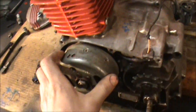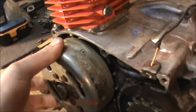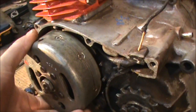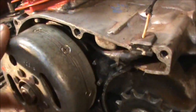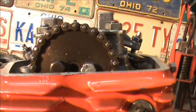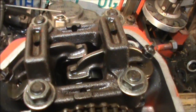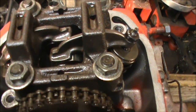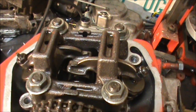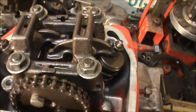What you'll do is rotate your flywheel until — see, I've rotated 180 and it's lined up right there. But you can see the circle's not lined up and my cam lobes are both pointed up. That's not what you want. You want to make sure the cam lobes are down. You can see the cam moving the rocker arm rotating — that's still on the exhaust stroke.